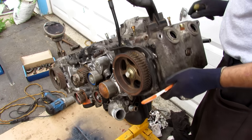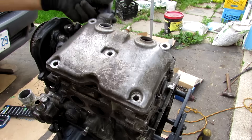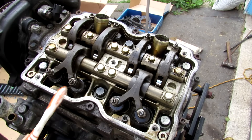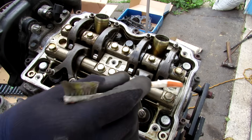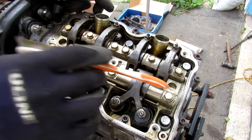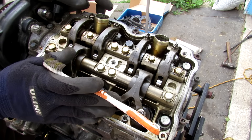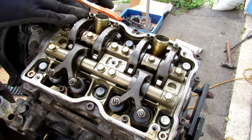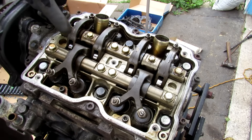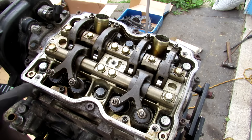I'm going to start working on one head at a time, rotating the engine and removing all the valve cover bolts to take off the valve cover itself. Because this is the single overhead cam version, it has a single camshaft running down the center driven off the timing belt. Here we have the rocker arms that rotate against a pivot shaft — the exhaust side on one side and the intake side on the other, along with the spark plugs. You can see as I rotate the camshaft how the rocker arm pivots to push those valves down and open them into the engine.